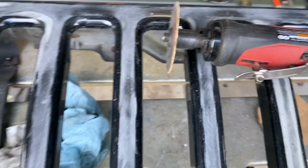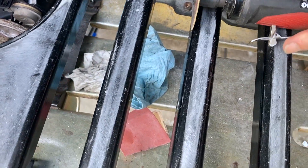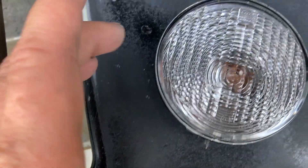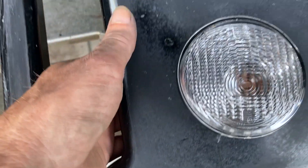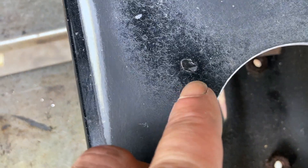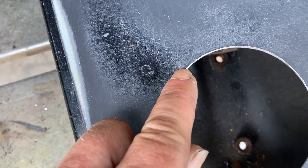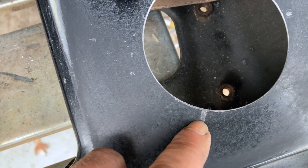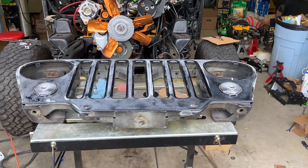To make the notches: you'll have three of them — two bigger ears and a smaller ear. I just use a die grinder blade; it's pretty much the size of the blade and it works for me. I off-center it so that when it falls in, I twist to the left. You have a right and a left plug, so I orient it so the plug faces the right way for the wire harness. I take my pencil, mark the positions, then take the die grinder and hit the marks, push it down, and check if the short ear lines up, then cut.